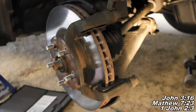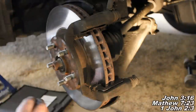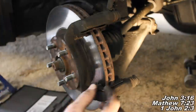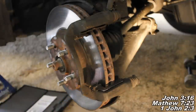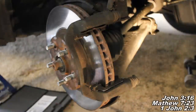Now we're going to talk about turning your rotors. There are a couple reasons you could turn your rotor — that's to keep your present rotor. You can pay about $10 to Napa or O'Reilly where they have a brake lathe and they will turn your rotor for you; it's a cheaper option than buying a whole new rotor. The reason you'd want to do that is if you've worn your brake pads down metal to metal and the metal pad is wedged in grooves and all torn up — you don't want to put new pads on that torn-up surface. So you'd want to have your rotor resurfaced to ensure longevity for your new brake pads. The other reason to have your rotors resurfaced is if you're having vibration problems — if you're driving down the highway, apply the brake pedal, and feel your brake pedal vibrating, that would be a good reason to have your rotors turned.